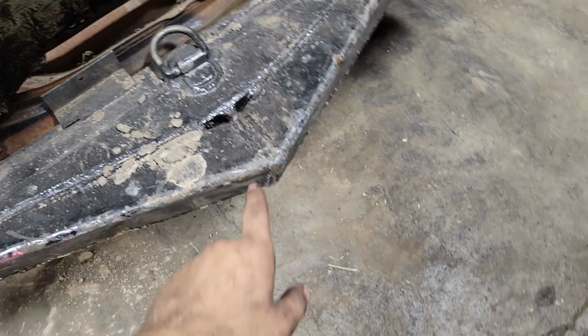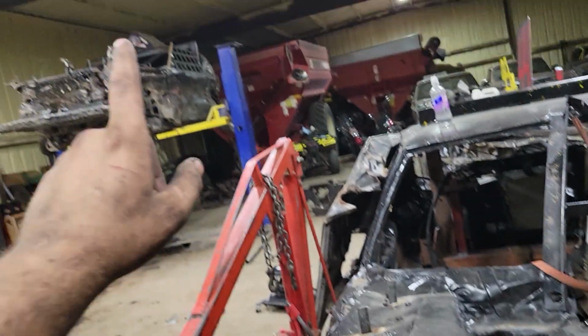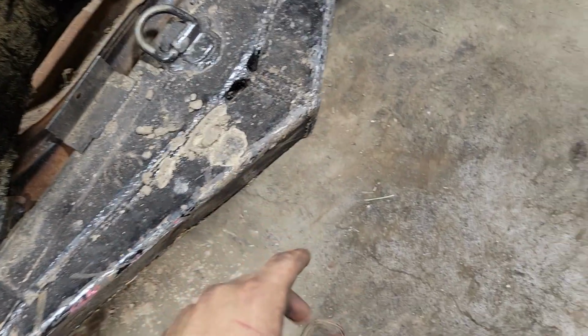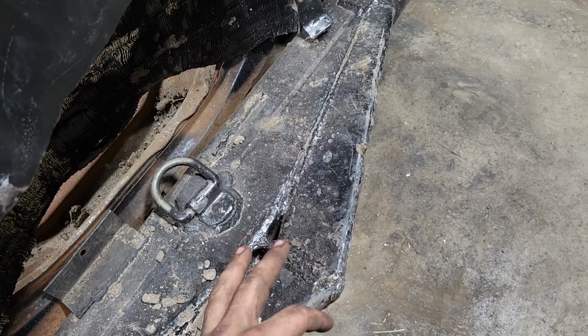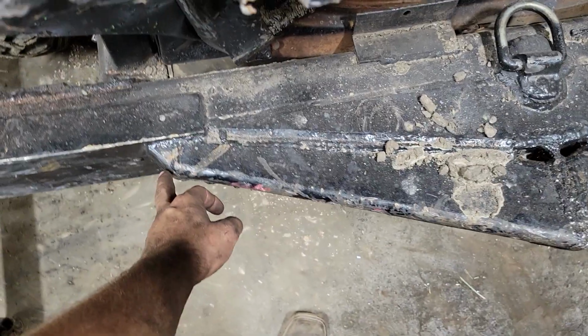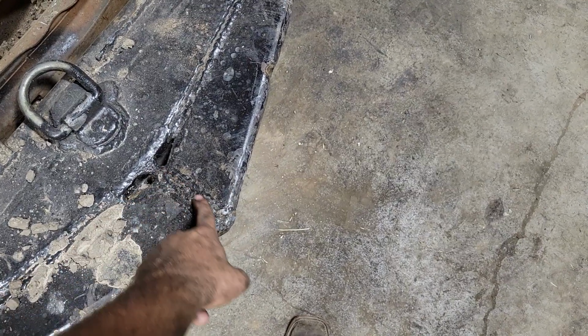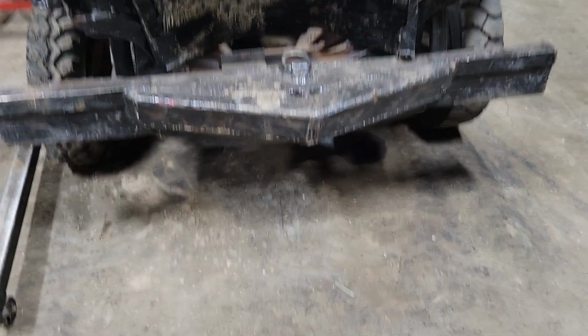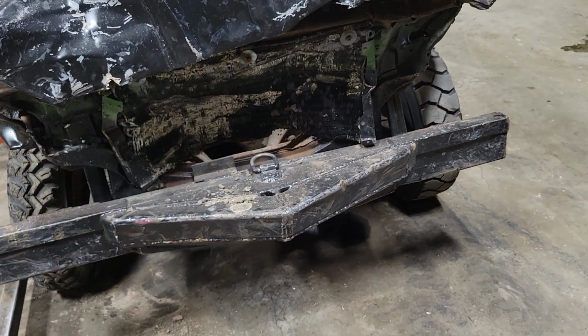Everybody was clearing me. But 2 weekends before the show, I added the point to make it into a Chrysler replica. This was the flat bumper that I ran on my Lincoln and that red and black LTD. So I added the square tubing. I made some templates and just kind of rigged it up. Every measurement is perfect for a Chrysler pointy from end to end. It's got the bevel, the face is slanted, all the goodies. But it's only 1/4 inch tube, and then there's a 3/8 plate in the point of it, which this bumper did help me a lot. I destroyed somebody's tire pretty good, and it prevented me from getting cleared and other stuff from hitting my radiator quite well. So it was worth it.